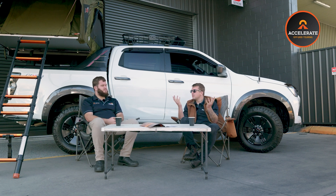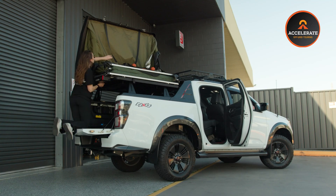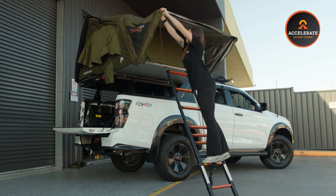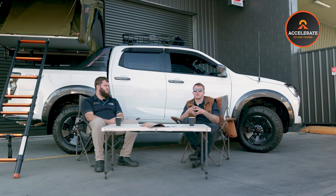It's a really good basic touring build just out of the car. He's got the rooftop tent on top as his sleeping quarters, so it's very much an all-in-one — jump in your car and away you go. We're doing a lot more of these behind-seat systems, with 100 amp options and increasingly 200 amp options, because everyone wants to use an induction cooktop and coffee machines while out in the bush.